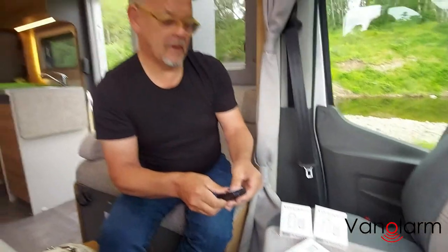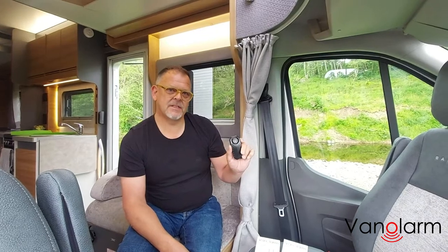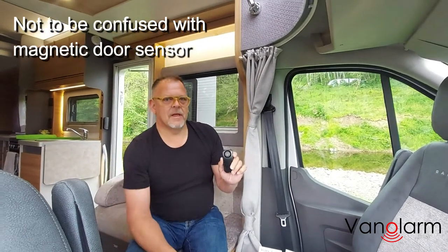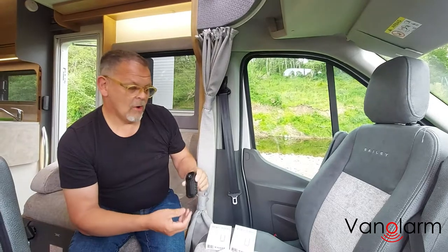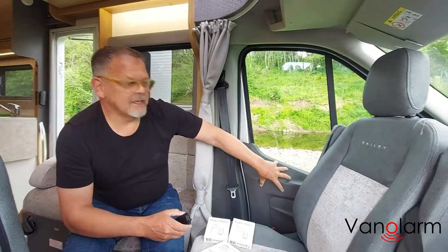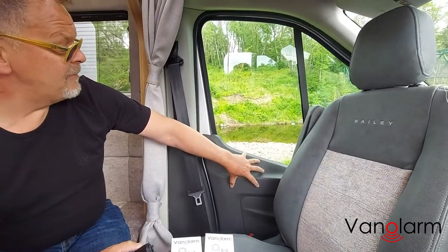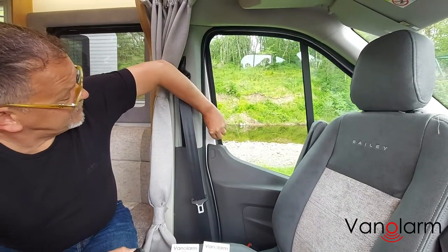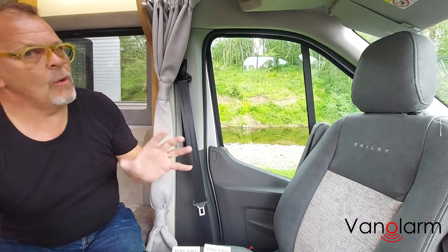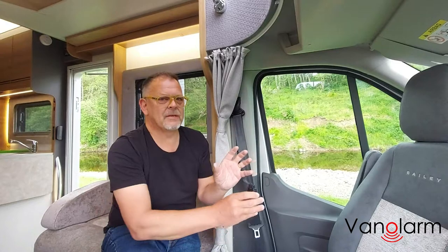What we're looking to do with the siren alarms is — they also act as your door sensors — so we're trying to get these as close to the actual door handle as we can on the outside of the van. We also have to consider that padding can sometimes stop some of the vibration, so if possible we're looking to fit the unit to the metal structure of the vehicle. If we can do that, that's best because the vibration will come through the metal structure better than through an insulated panel.